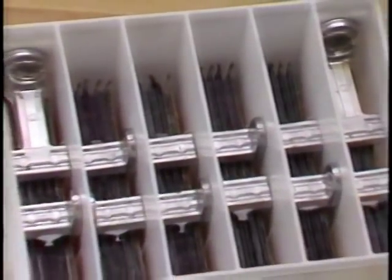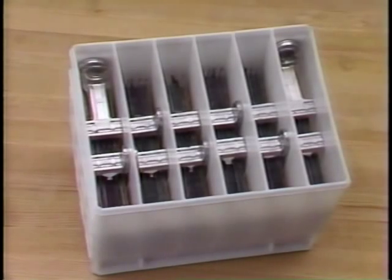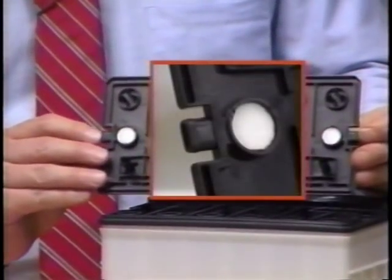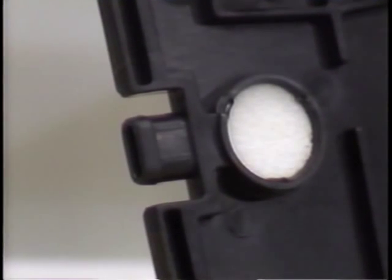Let's look at some of the major design features of a Freedom battery. The polypropylene case has an internally ribbed design — it's exceptionally strong and durable. Because the case is translucent, you can look right through and see the electrolyte level, making it easy to determine if there's been a leak. This liquid gas separator in the cover traps escaping electrolyte and returns it to the reservoir. Two small vents let extra gas escape during temperature extremes and charging, and special flame arrestors in the vents help protect against the possibility of an exploding battery.